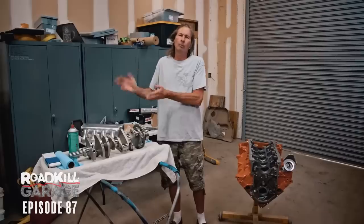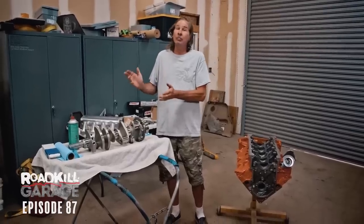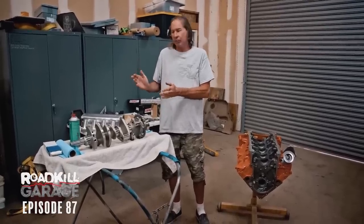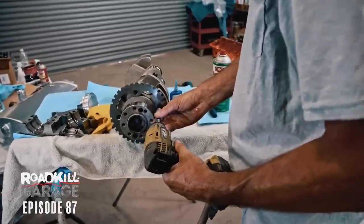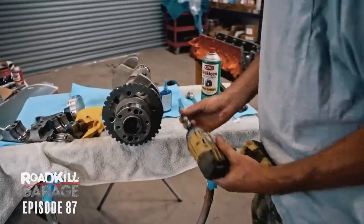The guys did a great job pulling the engine and trans, so that means it's cleared out and ready to get the 5.7 Hemi, which happens to be all around me in pieces. Now, one of the problems I ran into with this particular crank is that it had 4-bolt mounting for the reluctor wheel. That was a later modification on the Gen 3 Hemi. The earliest engines had 3-bolt reluctor wheels, which I happen to have on this particular engine.